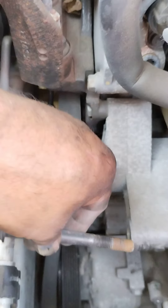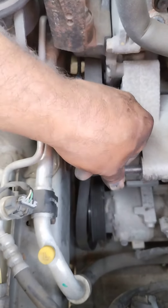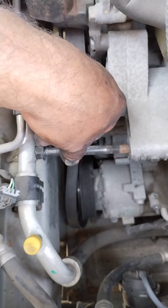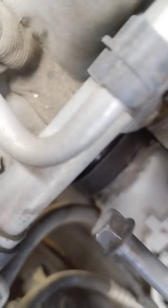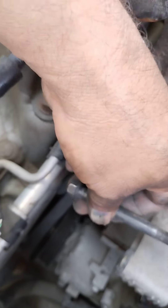The bolt hits right there on the AC line. Right there, you just loosen the little bolts in there with a number 10, lift it up, lift the lines up, and it comes out easy. You can do it without removing the bolt completely.